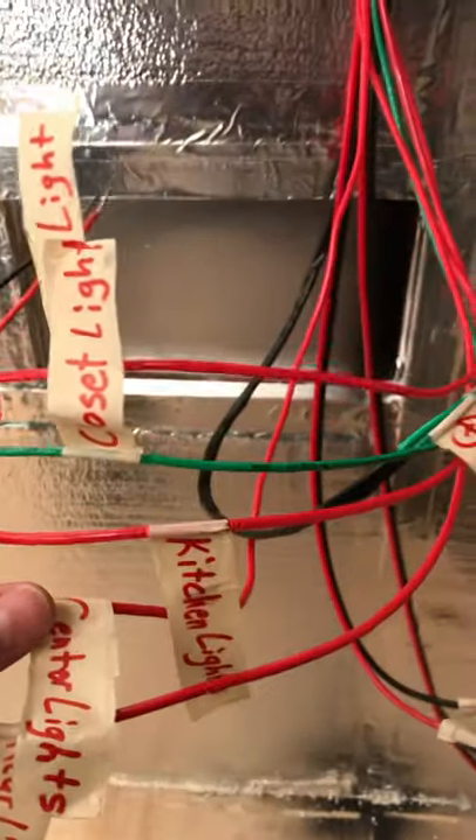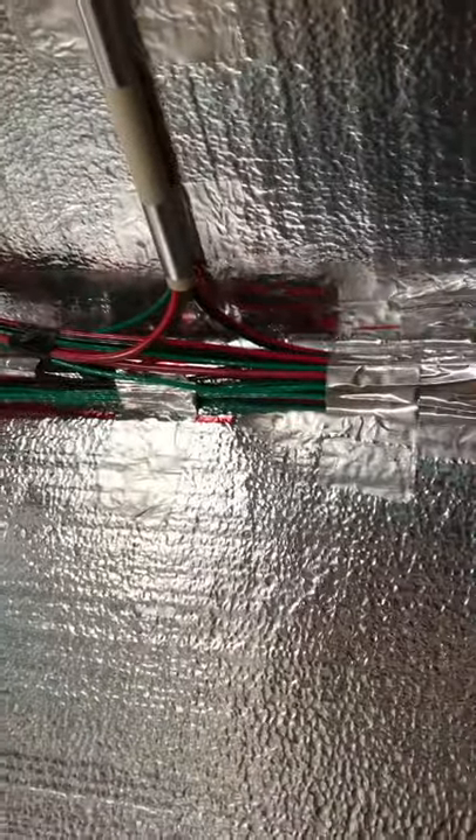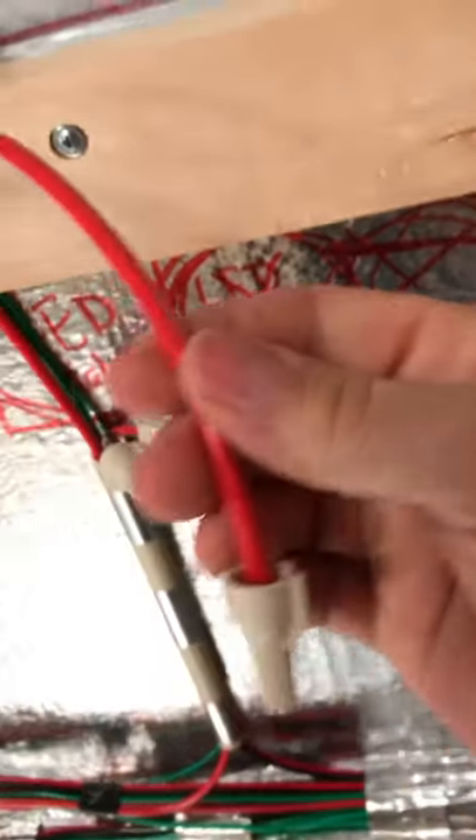A few people have already told me — I did the best research I could to figure out what gauge wire I needed, but apparently I did some serious overkill. I wound up running 14-gauge for all the lights, and anything bigger than an LED I used 10-gauge wire for the inverters. There's going to be an inverter in the kitchen and two over by the beds. I found out later that's just way overkill, but I think it'll be all right.